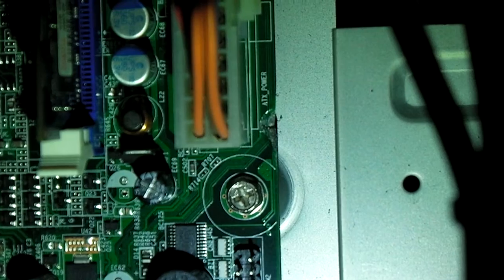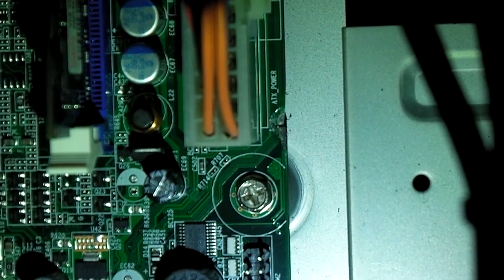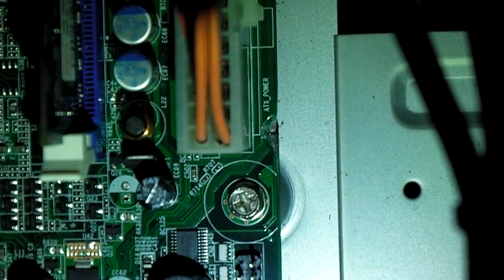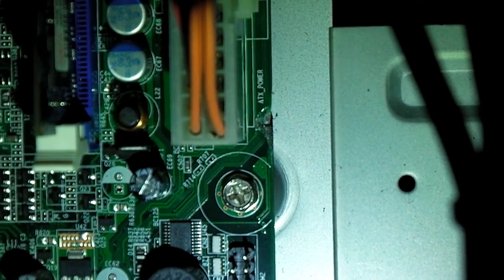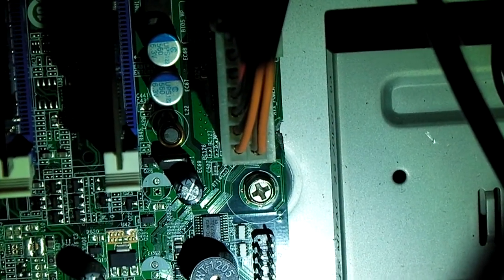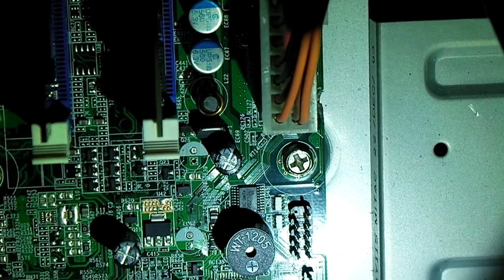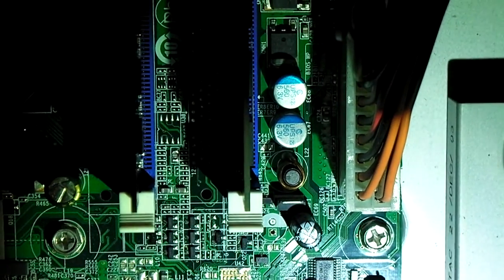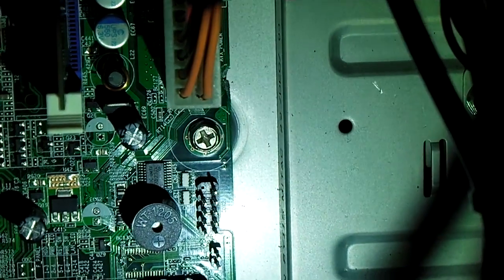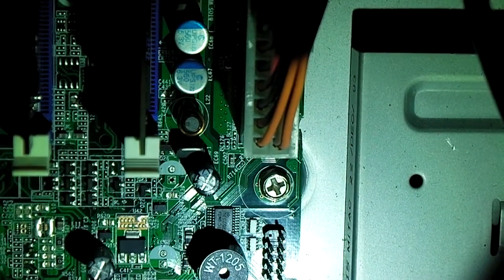I tried manually jumping the power-on signal into the power supply, and that did force this thing to start up — all the fans and stuff ran. But I did not get a POST, and within 10 seconds I started to smell something, so I unplugged power and then noticed this spot right there. The motherboard has been damaged and it's rendered it unusable. What I'm going to do is contact this eBay seller. I don't think this happened in shipping — it seemed like there was some mishandling by the seller's technicians that caused damage. My theory is they tested it still in the computer it came from, it worked, then when disassembling it to sell, perhaps a screwdriver slipped and went right through the board — cracking this and damaging the ATX connector area.